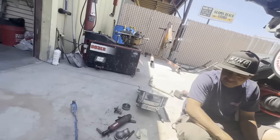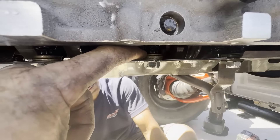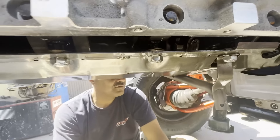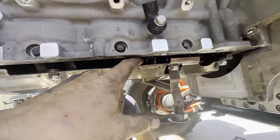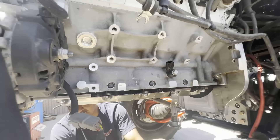I got a couple more wires to hook up for power on the starter and then we can get the motor put back in. You dropped your oil pan just to do a little inspection and check out the spacers on your windage tray. This has definitely got a stroker crank in it because the windage tray is spaced so the crank doesn't hit it, and I see all ARP hardware underneath there. Definitely not a stock motor.